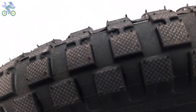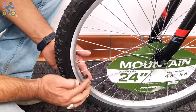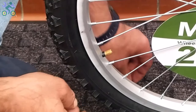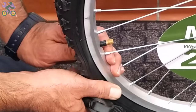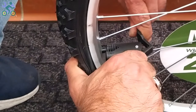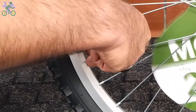After inflating to 20 PSI, sit on the bike to check the tire pressure. If the tire is not fully inflated, increase the amount of air. Remember, the weight of the cyclist determines the amount of tire inflation. To inflate the tire, first remove the valve cap and then put the air pump head on it. Sometimes this is difficult because pressing the tube valve causes it to go inside. If the tire is slightly inflated, first deflate it completely. Press your thumb on the back of the valve and place the air pump head on it. Inflate the tire halfway and make sure the tire is still on the rim. If part of the tire pops out, release some air pressure, put the popped-out area back inside the rim, and reinflate it again.